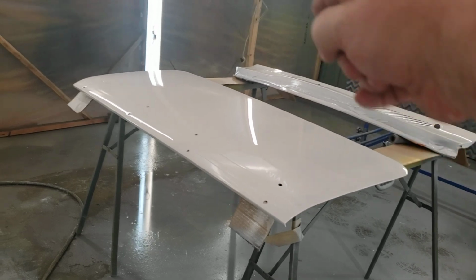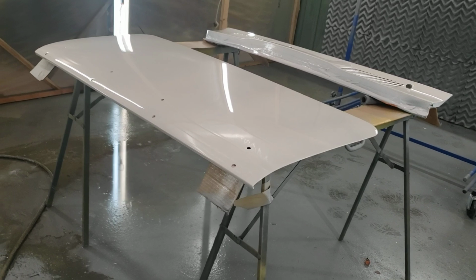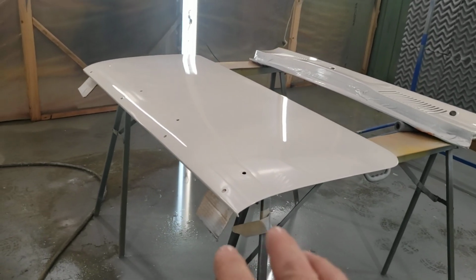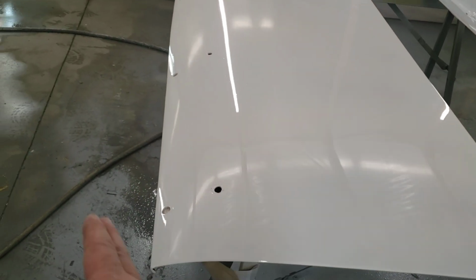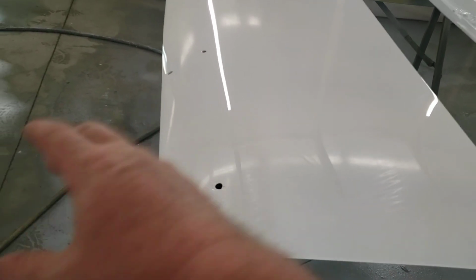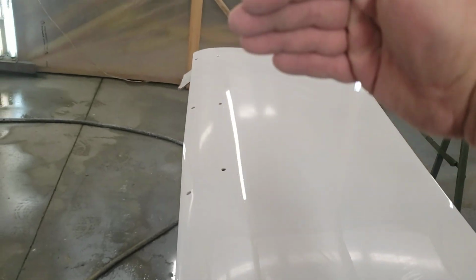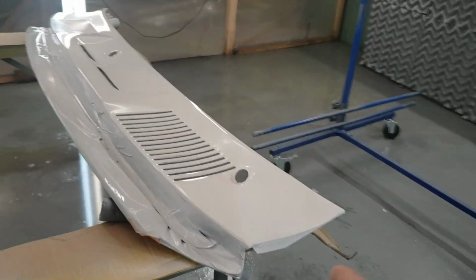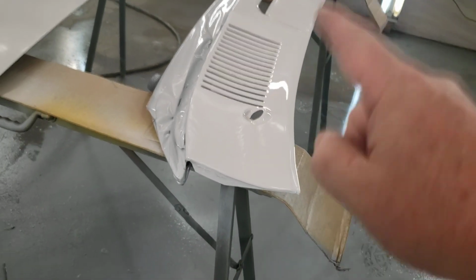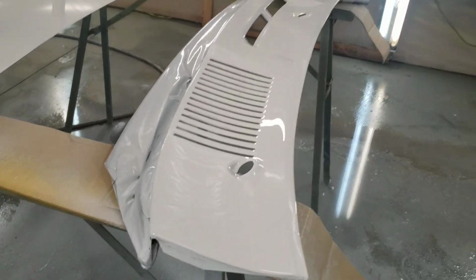And then of course we did catch that edge around real quick. We just have a tape on the bottom of the edge because we're not redoing underneath. But basically once I did all around the edge, I caught this edge and I came up real nice. And as soon as it laid out where it was nice, again I went to that 60-70% overlap and worked my way across the whole thing. When I got to that end, it looked really good. I hit the front edge of this piece up to where it's taped. And then I came to the back side, I went all the way around the perimeter, and this one I just basically shot right across in one shot.